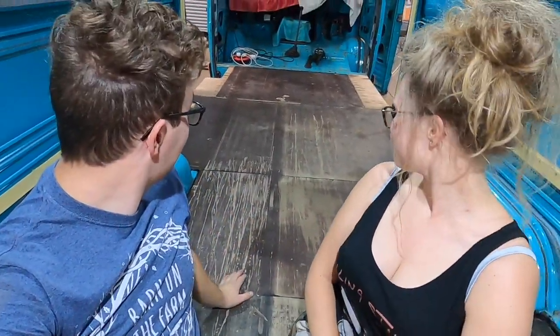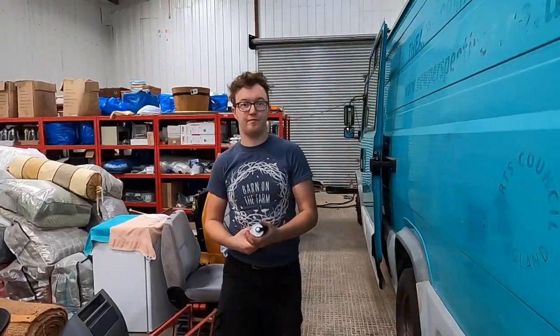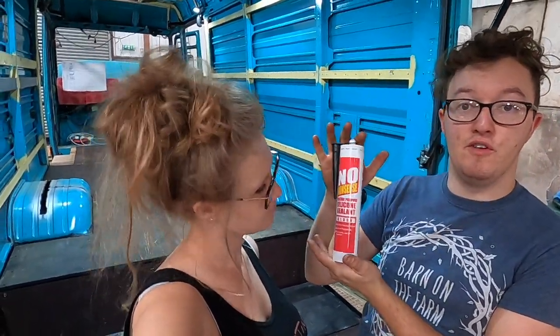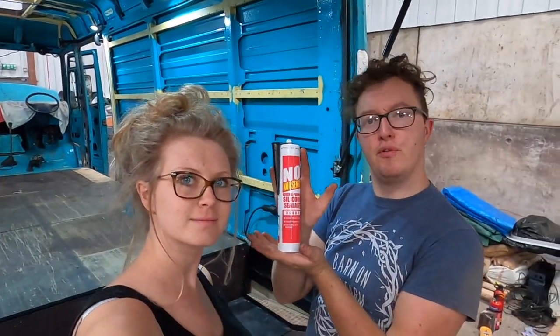It looks so much better on the underneath — it's beautiful, smart, and even underneath, while the top is a bit mucky, scratched, and horrible. We're going to lift this back up and then stick it down again with black silicone. We're primarily using a general purpose black, UV and waterproof silicone. We run two parallel beads so that nothing can get into the centre of the chassis, making sure they're nice and thick, and then dance all over it to squish it all down.